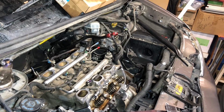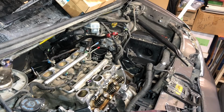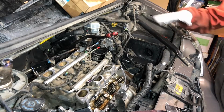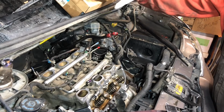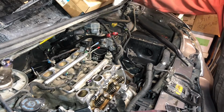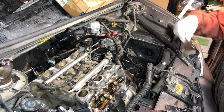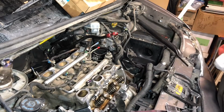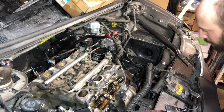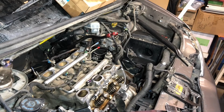So I'm gonna go back to time lapse to do these rocker arms. All I'm gonna do is make sure the oil galley holes are clear. They've all been covered up, so they don't really have to be cleaned. I'm gonna spray them off. I'm gonna lube up the valve stem surface and push rods, get everything just ready to go. Torque it down. Valve covers on.